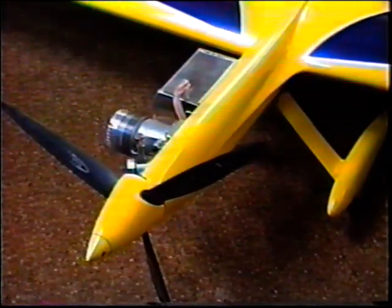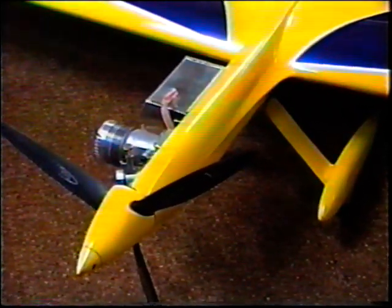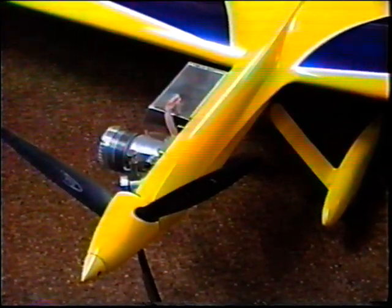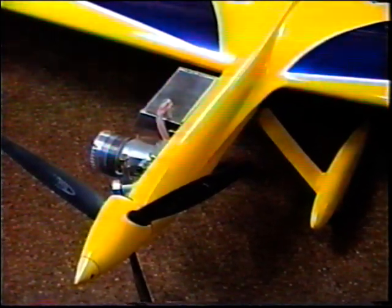Now in that same vein, let me suggest another thing. Any first flights should always be a little bit on the rich side, because you never, never really want to have that dead lean run that eats an engine early on. Once a tank has 50 flights on it, typically not much stuff is going to come out of it, but in the beginning, it can be a real problem.